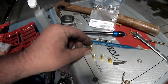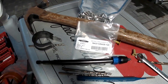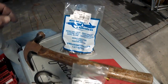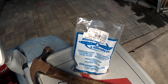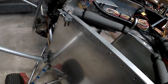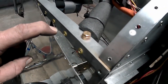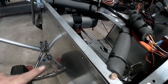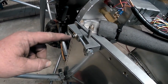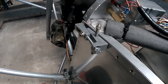These little things are called rivnuts — there's the part number. I also got number-eight stainless steel screws, and there's the part number for those — you'll probably have to pause the video to read them. That allows me to use these little Phillips screws to put panels in. You can see all the rivnuts I've already installed on the back. You can buy a really fancy expensive tool or you can get this one, which I think was about 20 bucks for this little contraption.